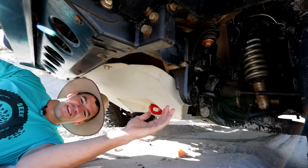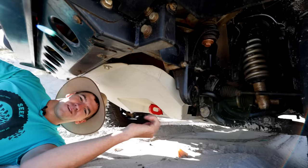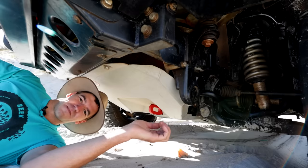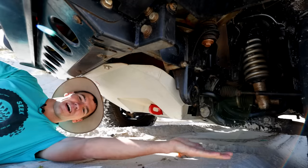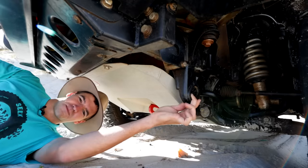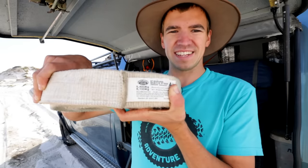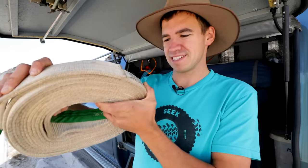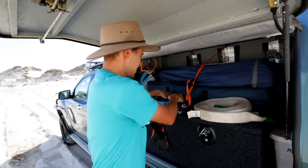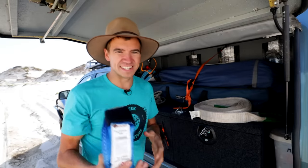If you're really stuck and have to use a tie-down point, do everything you can to make as little friction as possible in the recovery — move as much dirt, sand, and mud from in front of the tires, and clear anything the vehicle is hung up on, just to put as little strain as possible on that point. Second thing: in any recovery situation, only use rated recovery gear. This snatch strap is rated to 8,100 kilograms minimum breaking strength; this tree trunk strap is 12,000 kilograms.